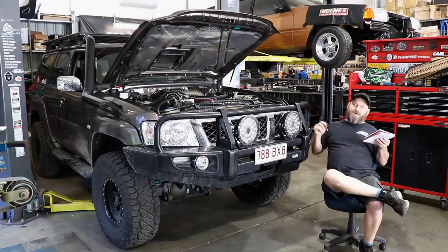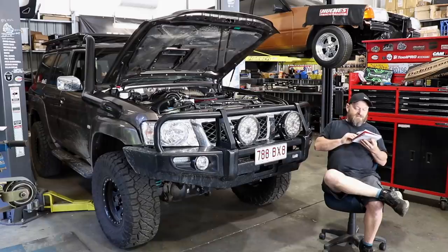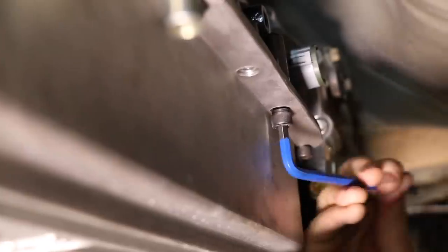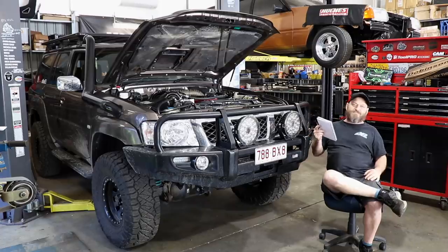Economy - so far it's been pretty bad, but half of the usage was on a dyno, so we'll wait and see. If you're plowing into it, it's going to use fuel. It's a massive engine and the car's reasonably heavy - that's just how it is. Issues I've had that I need to change: the shifter. We were stoked with it when we got it - it's got that Tiptronic function and fits in the console well and looks great - but it doesn't go back to one, two, three gears. With the transmission, it doesn't have engine braking unless you've pulled it down into first and second gear. So we're basically free-floating going down big hills, relying on the brakes instead of the giant engine with heaps of compression. I'm going to have to replace it with a gated shifter that doesn't have the Tiptronic function.